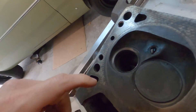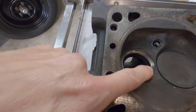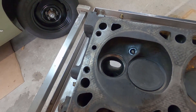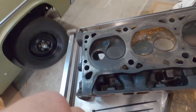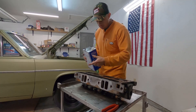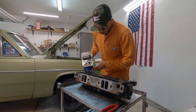Did a little bit of grinding and you can see there's some pitting on the valve - not great. I think the head is probably going to look about the same. Yeah, there's pitting, it's not getting a good grind on there at all. It got real nice right here and then it looks like it's not touching anywhere else - it's grinding right there only. I don't think this is something I'm going to be able to fix. The head and all the grinding is just right there, it doesn't look like it touched anywhere else - it actually looks like the valve seat might be worn out. Not good.